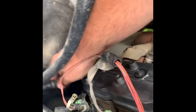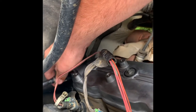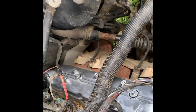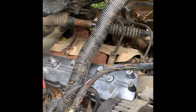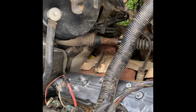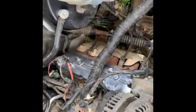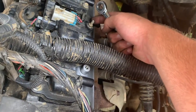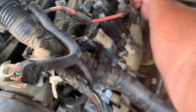Now go back through and put the PCV valve clip back on — snap it back on, you'll hear a thud when it clicks. Now the fun part is putting the coil packs back on. Your five studs go back where they go. You've got one at the front, one under this big wiring harness, one right here for the third, one past the third coil pack, and the last one behind the last coil pack. Then snug the thing up.